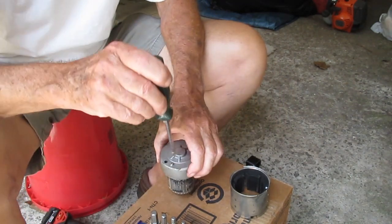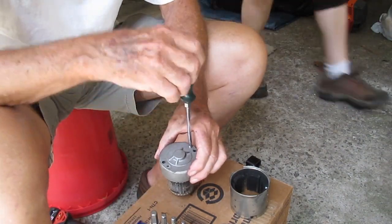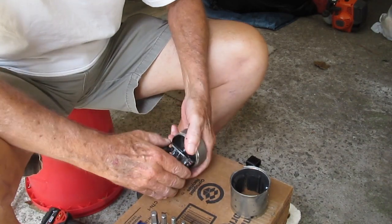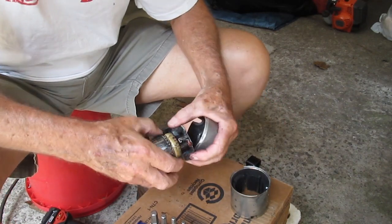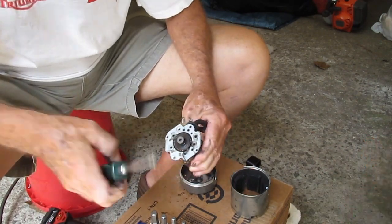We're going to take off the rear now to access the brushes, and you'll see that two of the brushes are just burned out. Get that cap off, and there's a locking washer that locks the brushes on — just pops off. Brushes come off.